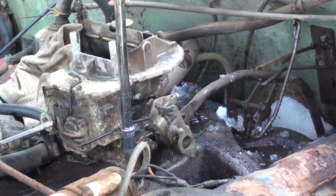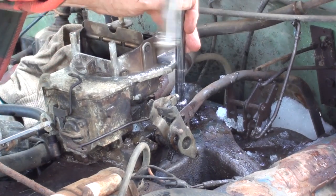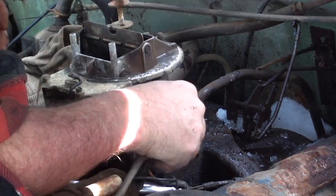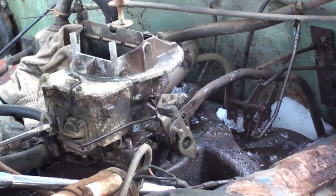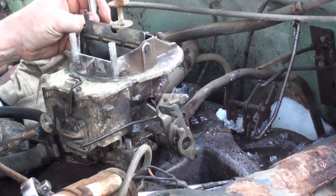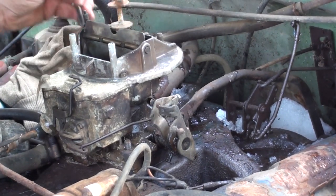It's not totally imperative that you retain the nuts from this, but they are a five-sixteenths fine thread with a seven-sixteenths hex instead of a half-inch hex, with which you can put a socket on there more easily because of the close tolerance of the air horn to the base plate. Otherwise known as the angle of the dangle. A wobble extension would be much better.